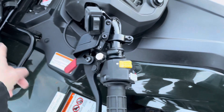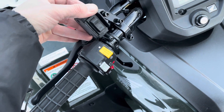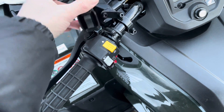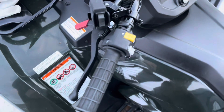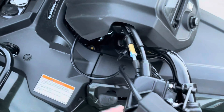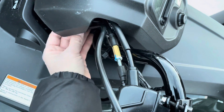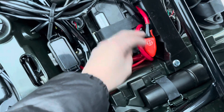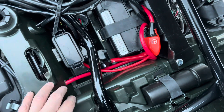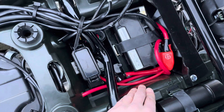You can hear the contactor clicking and the winch works. I need to tighten this up but I think it's going to go on top — either on top or down at the bottom here. I ran the power wires to the winch motor through factory holes — there was one here and one on the other side. I put some zip ties but I'm not very impressed with them and I don't have snips here, so I can do better — but it's not too bad, and it works.